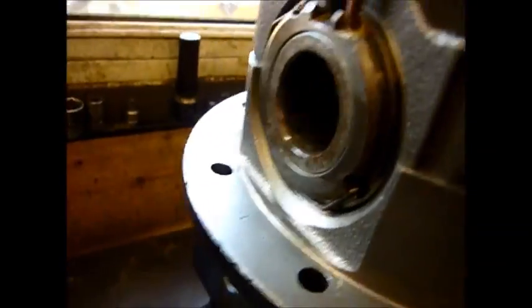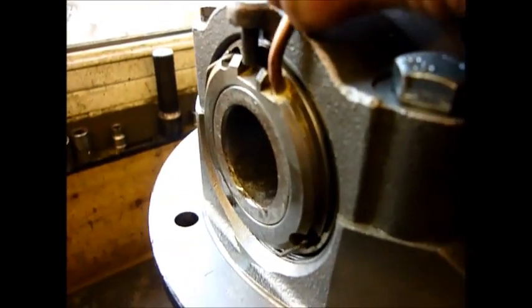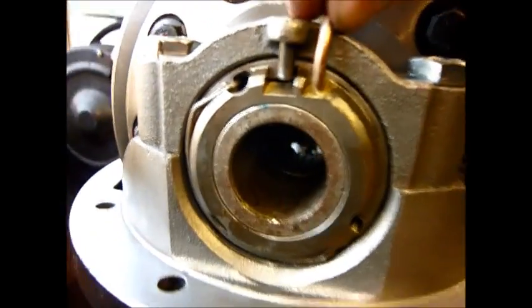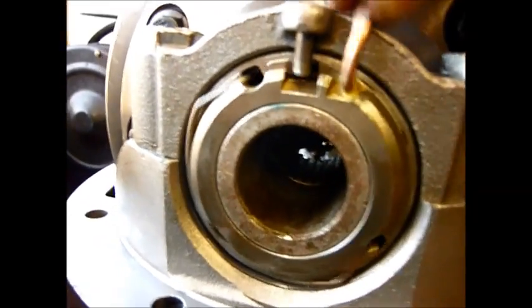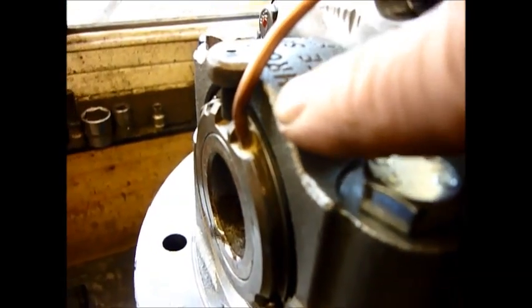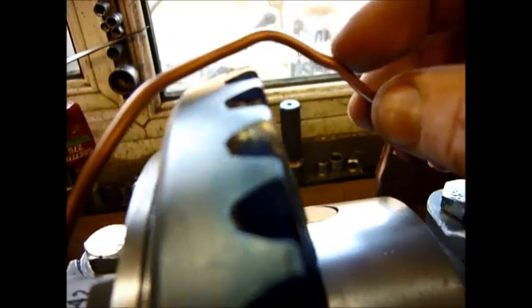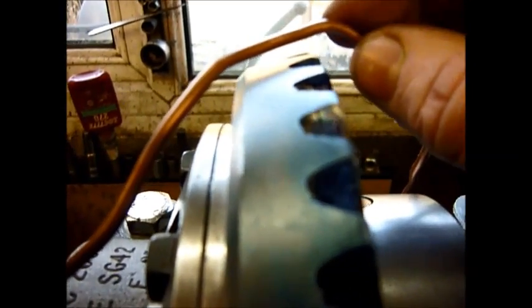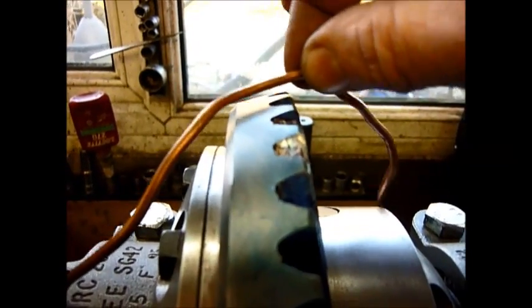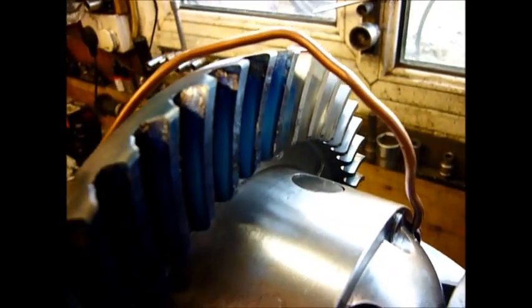They switched it from the other side. Not only that, but the locking pin here doesn't really lock it — you can actually move this backwards and forwards. Here's the air pipe, which isn't really held in place; it can move around quite considerably, which can cause it to chafe off. It goes over the top of the crown wheel, and if set too far or too close, it will actually crush down or pull down and chop off. This pipe moves around far too easily, so the fact it's loose here and loose up here does not make for a very good unit.